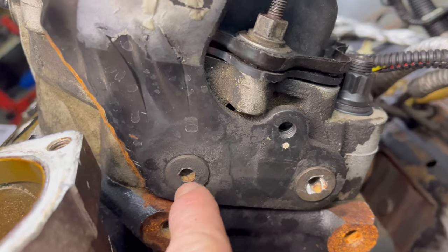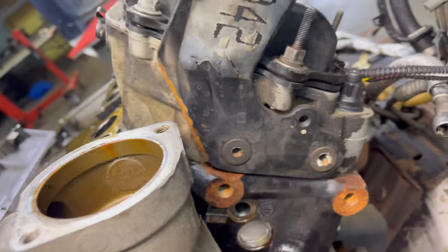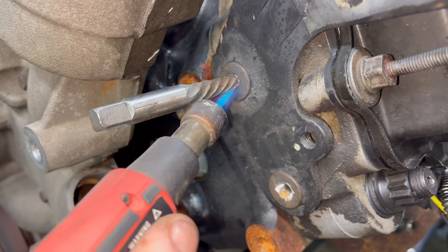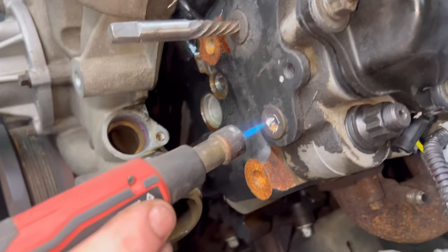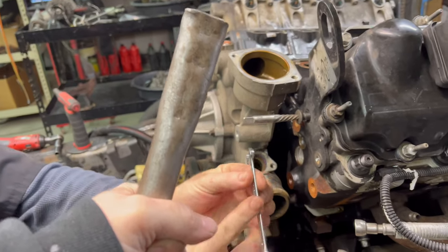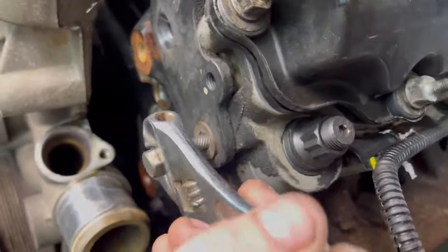I've stalled enough. The boss cannot stay on there. We will replace the rocker box if we have to, but we won't have to — that's coming off right now. I really don't do a lot of welding nuts; generally we find it easier to drill a hole. I don't know if it's going to work or not on that one. We missed it, but I was pounding on a bolt extractor and Julie was spinning it with a wrench — she had that bar all the way up in here, but I got it out. Good deal. Got it.